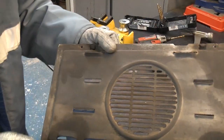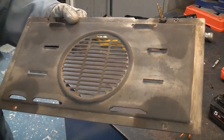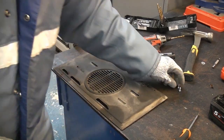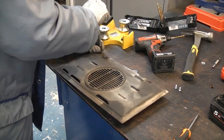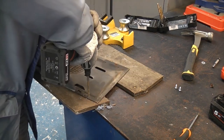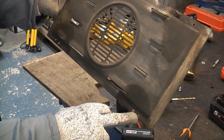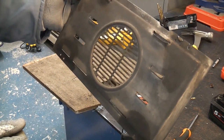I've brought the back plate out to the garage. These four holes are no longer going to fix the plate back in position because they've rusted away at the back, so we're going to drill four more holes approximately 20mm away from the existing holes. I've got some new self-tapping screws. We can put that in position in the oven — there are still two tabs at the top. Once it's in I can spot through using a smaller 2mm drill bit and then drive the self-tapping screws in.